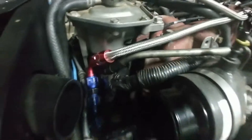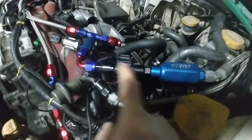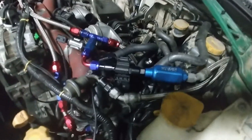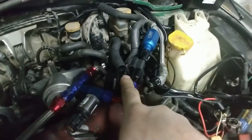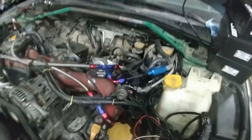It's buried behind there. Then you have the flex fuel sensor — that's the actual measuring device — and it comes with two different brackets to secure on the side of the car. For the '04 and '05 there is actually no room to put the sensor against the firewall, so they give you a sticker if you want to try to stick it somewhere. I just put it in line with the rest of my lines. I also have a fuel filter just in front of everything in case any debris gets into the system.